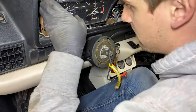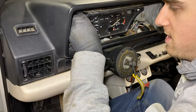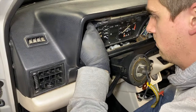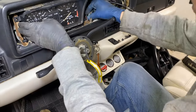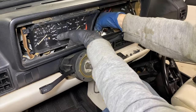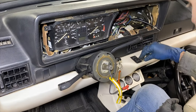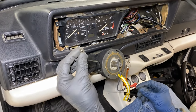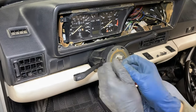Next, we're going to have to reach around and attach the speedometer cable — just kind of feel with your hand. Then it's time to screw the instrument cluster in with these two Phillips head screws. If you didn't quite keep track of what came from where, it's going to be the one with the washer attached. The previous owner lost one, so now we're stuck with this one.